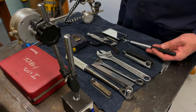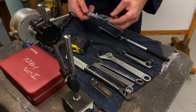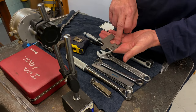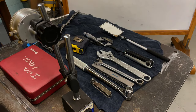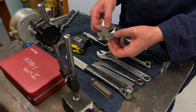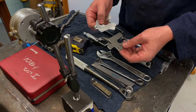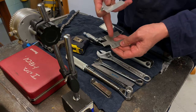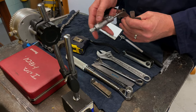I have a micrometer here because we need to measure all of the shims. These shims have a number stamped on them, but you have to look at how they're made. This one is made from 100-thou stock and stamped from a big sheet of steel. This other one has been precision ground — you can see the surface finish, it's more accurate. The non-ground ones are just sheet metal stamped out, so you need a micrometer to check the actual thickness of your shims.